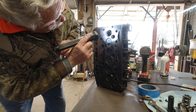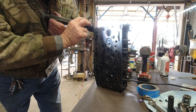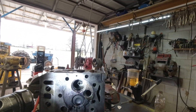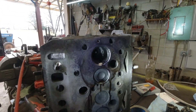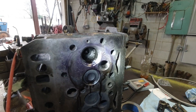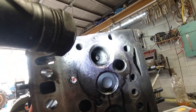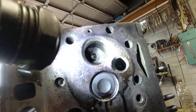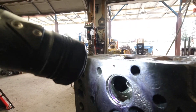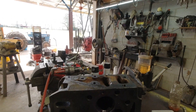It hits about halfway around, and I'll show you — I'll move the camera right around here too. If you look at the valve seat, right where the bump is at the bottom, it hits. And you can see it's actually removed the dye — you see the silver. But when you get over to this side, it's all still got the purple dye still on it. The valve is the same way.